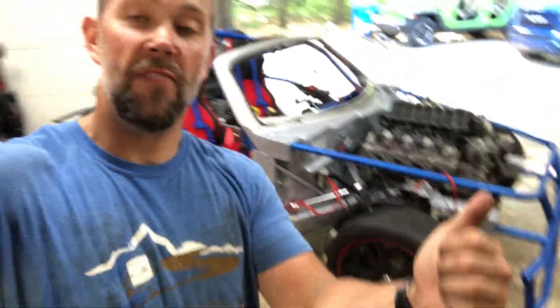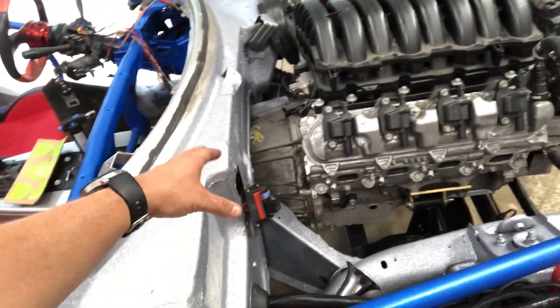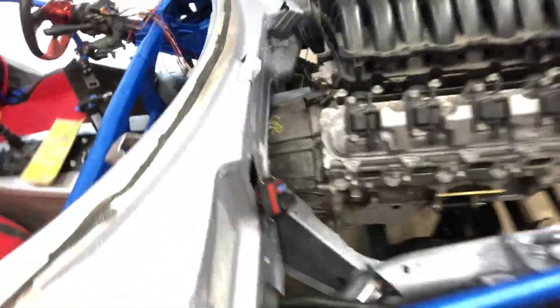It's been a couple hours and we did get the motor in - check that out, finally in there! It is super hot today here in Michigan, like 90-95 degrees, thousand percent humidity. Lewis already had to take off but not before we got the whole motor all in. Motor mounts are all bolted down, trans is all bolted down. Now with the 4L60 bell housing we're able to get six of the eight bolts - these top two we can't get just because of the differences with the direct injection. Six out of eight should be good. It did take a long time to get the engine mounts in because they were off like an eighth or sixteenth of an inch.